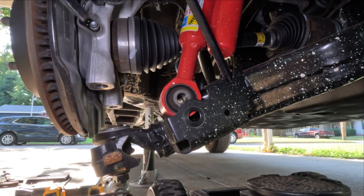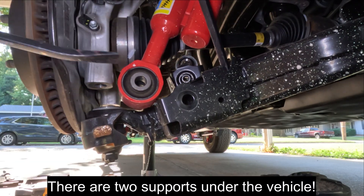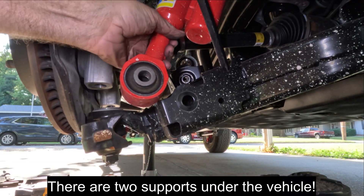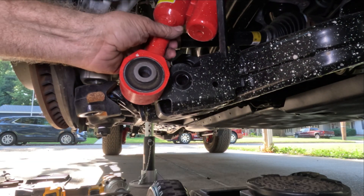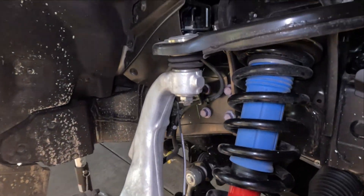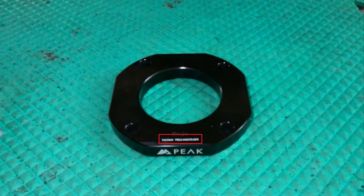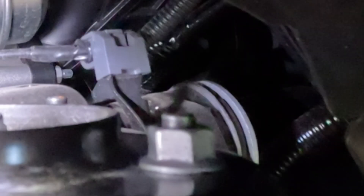The instructions are very thorough, but you don't have to remove the steering arm or shock from the pickup. The text on top of the spacer goes to the front of the vehicle. Top nuts are over three-quarters of the way threaded on — use thread locker.